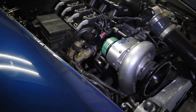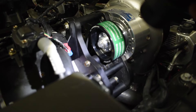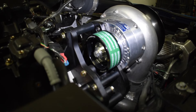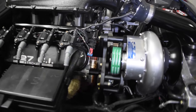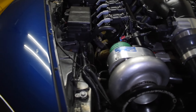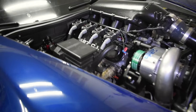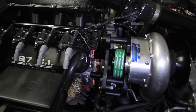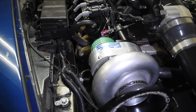With an 8-inch crank pulley combined with a 4.06 upper - our prior setup was running a 4.125 upper - so bigger lower pulley, smaller upper. I'm going to be actually overspinning the head unit by another 8,000 RPMs. ProCharger rated this head unit for 68,000 max, and with this combo I'm going to be revving it up to right around 76,000-77,000 RPMs. At roughly 69,000 with the old combo we got about 22.9-23 PSI, so with this combo I'm guessing somewhere in the 24-25 PSI range. The F1R is rated for right around 1,250 horsepower.